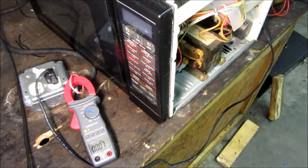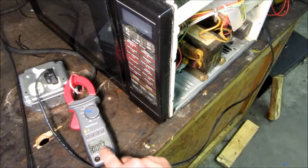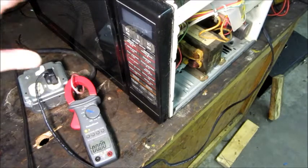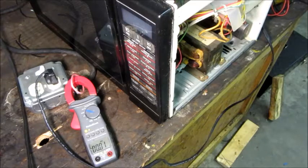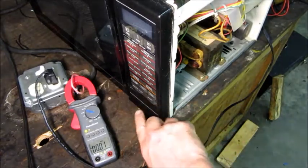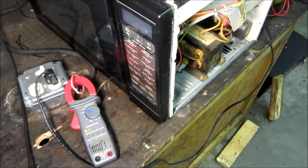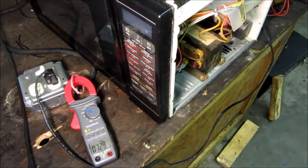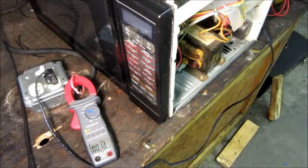I've got to take a little side trip from the fan and car projects because my parents' microwave oven stopped working, so we're going to troubleshoot this and see if it can be fixed. The symptom: I've got it on AC current and I have a bottle of water inside. My mom tried to heat something this morning and it didn't get hot. I pushed start and it's only pulling three amps — that's not enough power. This microwave should do a lot more than that, which makes me think some component in there is open circuit.